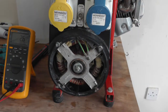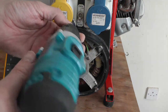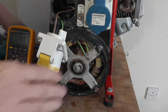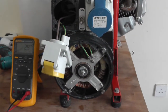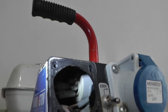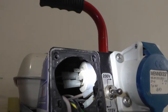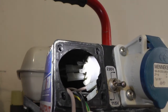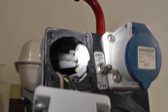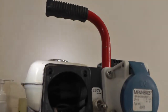If your voltage is low on these, there's usually a capacitor in here. I'll pull that out of the way and undo this. You can see in there — that is a capacitor. There's no writing on the box so I don't know the value, but usually around 20 microfarads. I'm going to test it, and if it's below 20 I'll suspect it and replace it. You have to pull one of the leads off to test because otherwise the windings affect the measurements.